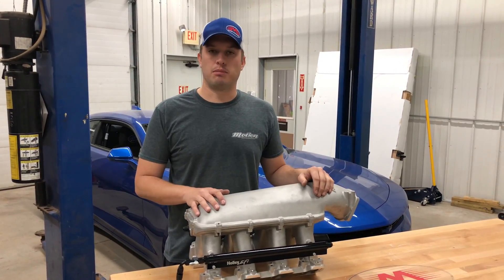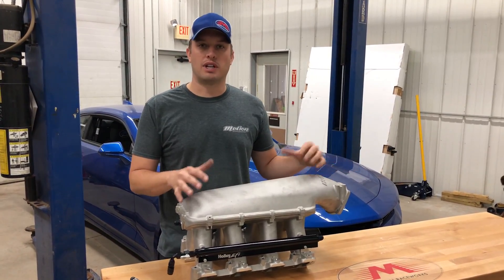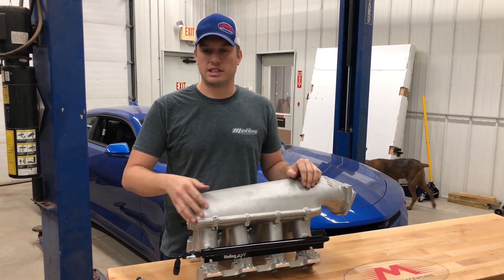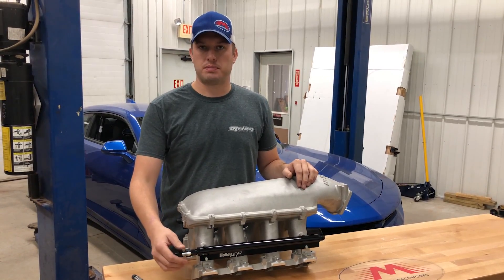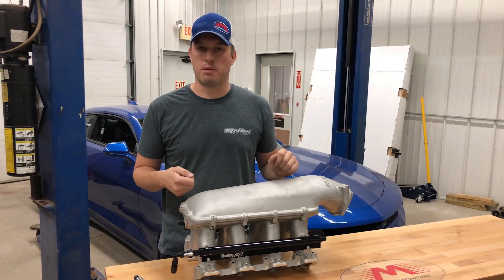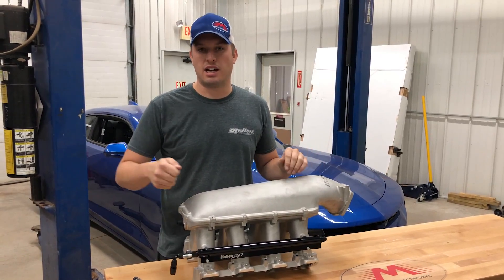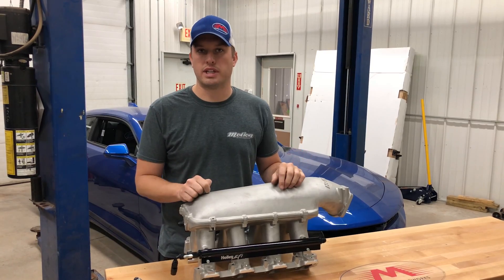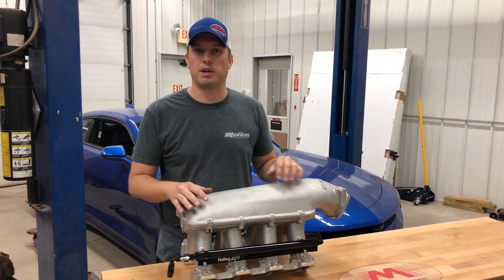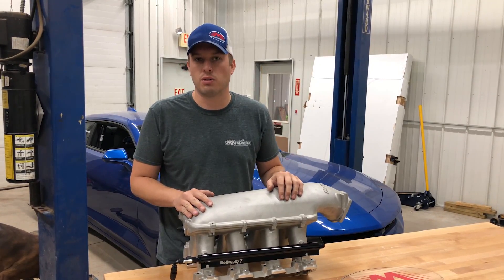The other nice thing is if you have a methanol cable-driven system and you like to do Drag Week or Rocky Mountain Race Week — just driving it between tracks — those cables are good and will last around a thousand miles without being serviced if run properly. Like our customer Garrett Mitchell, also known as Cletus, he kept his stock pump in the tank. Between tracks he would disconnect the cable from the belt drive on the engine, tuck that up, and run a separate line so he could power the fuel rails with the stock pump. It won't make a ton of horsepower, but it gets you from place to place and makes servicing the cable less of a concern on the road. Then at the next track, hook it back up and you're good to go.